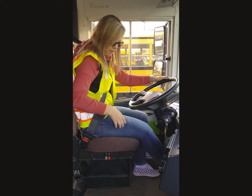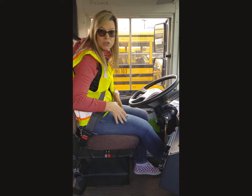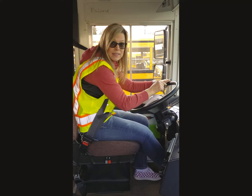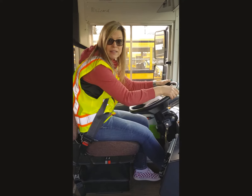And then I'm going to hold this for one whole minute. This is where the leg gets really strong. So in one minute, this must not lose more than 3 psi. 3 psi in one minute.